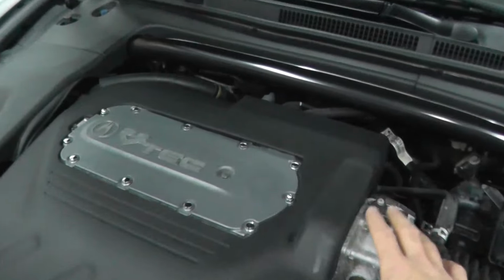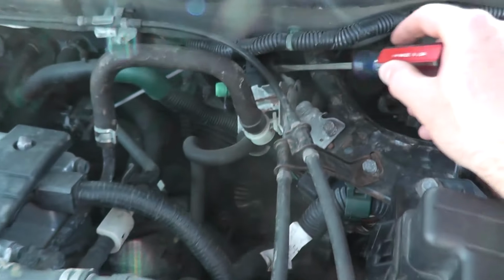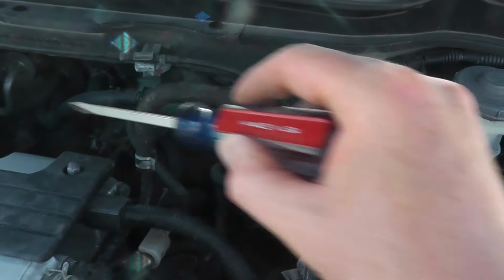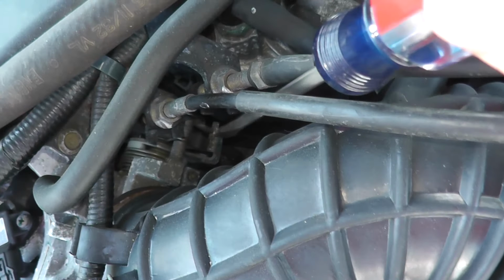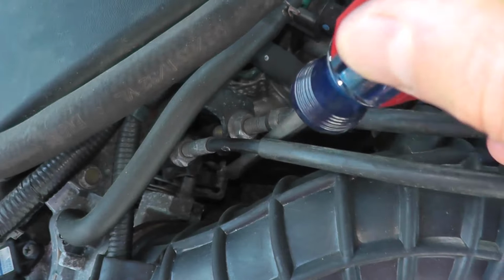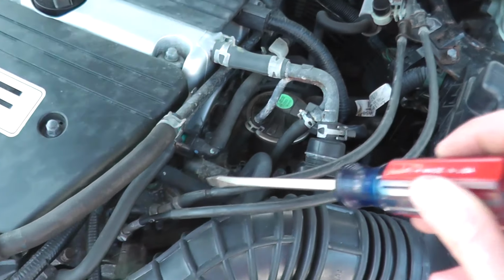Now let me show you the way it was for many, many years. Now take a look at this 2003 Honda. Right here's the throttle cable coming from the firewall, and instead of diverting to any electronic device, it's just your old-fashioned hookup directly to the throttle body. In fact, I'll start the vehicle in a moment. You can change the engine speed right from here. Much simpler design. You don't have to worry about any electronics. It's just the old-fashioned way of doing things.